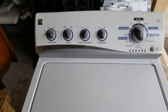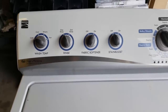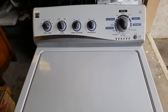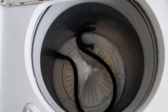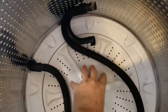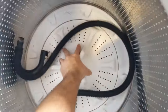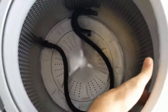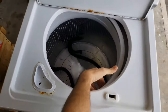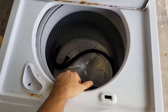We're looking at a Whirlpool here. I know it says Kenmore, but that's a lie — they bought the name. Same thing with Maytag in 2006; they bought the name and ruined it. This is really a Whirlpool appliance. This is one with an impeller instead of an agitator. You can do what's called a spring bounce test — you test the suspension rods by putting pressure on and seeing what it does. I want you to see the difference in philosophy. This tub moves all the way around. You'll never see that in a Speed Queen.